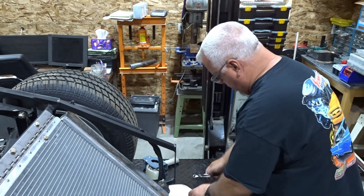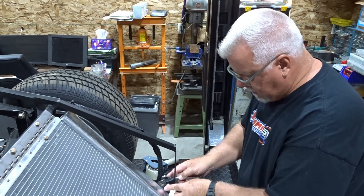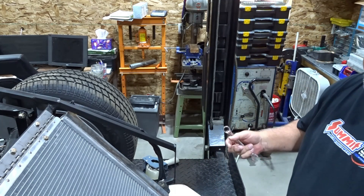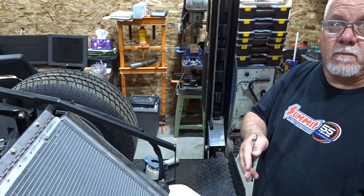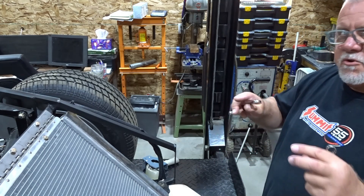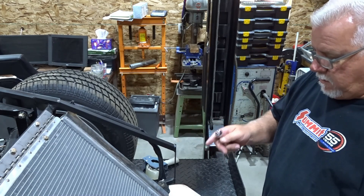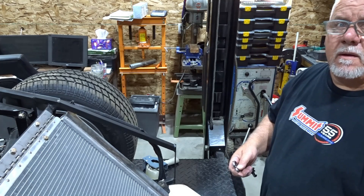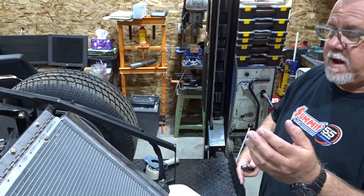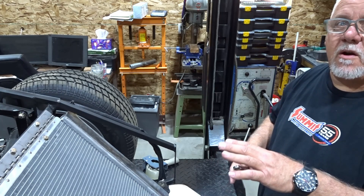That looks pretty good, so I'm going to tighten the bolts on this side. It's important to check both sides, but the radiator is solid enough that it's not going to move independently on each side - it'll hold pretty firm. Once you set one side and the other, it's going to be close to where it needs to be. When you're trimming your one-piece front aluminum you can make adjustments in your trimming to make it fit better side to side. Now we're going to start buttoning up all the cooling lines - all the clamps previously left off can go on and we'll make sure every clamp is tight for first start.